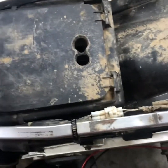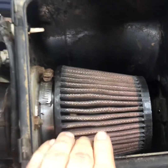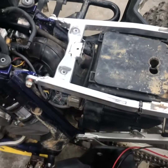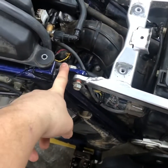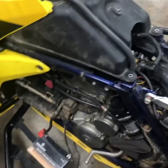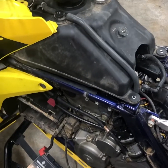We already cleaned the filter in the airbox here, but I'm pretty sure we're going to swap that out — it's not that great actually, I'm still not happy with it. I'd like to just put a foam filter in and that'd be good. And then obviously we put a new TPS sensor in and a new fuel regulator. So with a little love, this thing should be good to us.